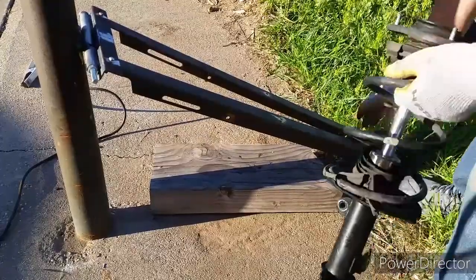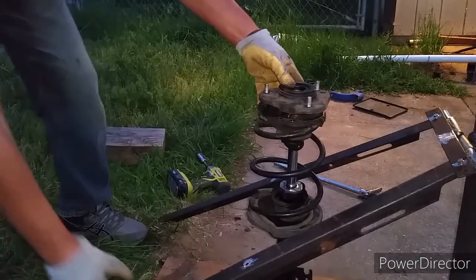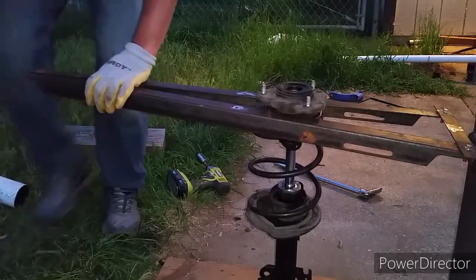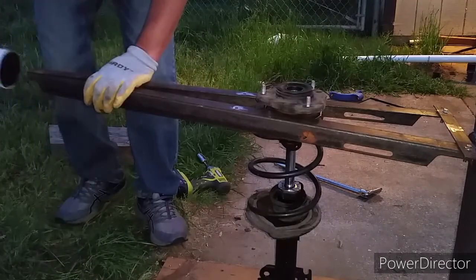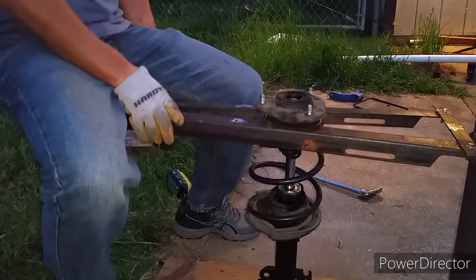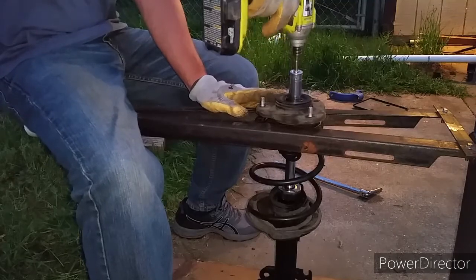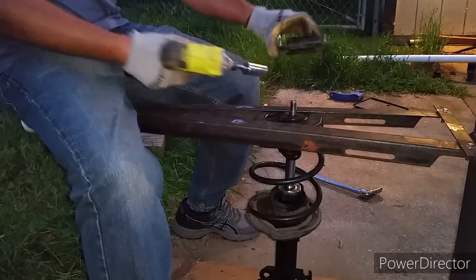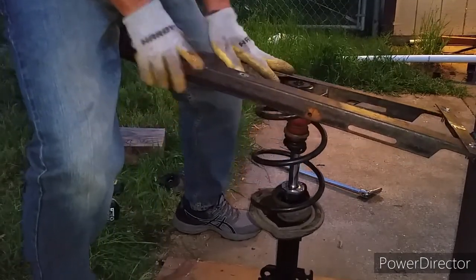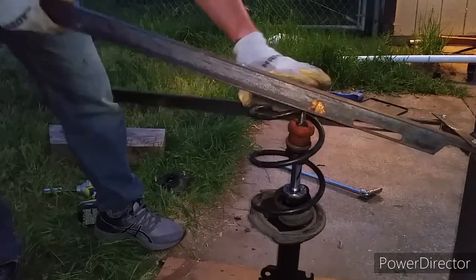Here it is — all done. Let me show you how it works. On the bottom I have a piece of block so I can adjust it if needed. Go ahead and put the arms in between the upper mounts, then use a piece of flexible plastic corrugated pipe to hold the two arms together. Then I sit down to add the weight and compress the spring. Once you remove the nut, remove your body weight — spring decompressed, everything comes apart. Easy, simple, fast and safe.